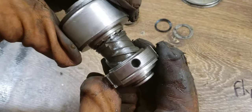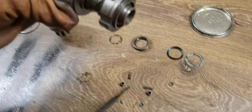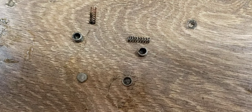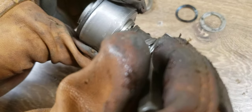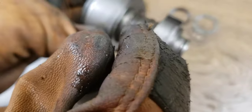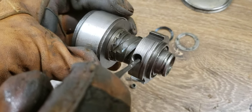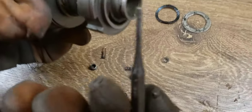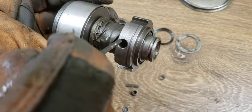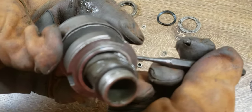If you can look down in there, there's a button, and those buttons are right here. There's two of them — why there's not three, I don't know. That button, let's say it's in here — it won't let it come back. When the engine kicks this, the centrifugal force spins it very quickly and these buttons will extend out because of centrifugal force and then allow this to come back into the ready-to-start position. That's how it happens.